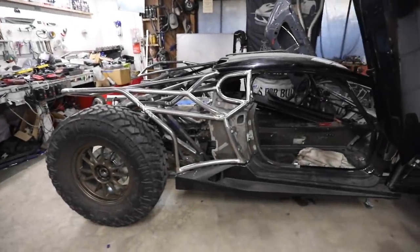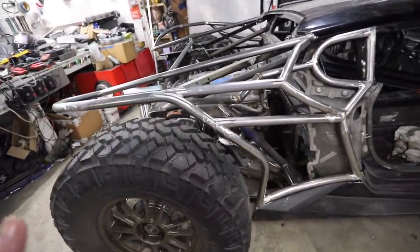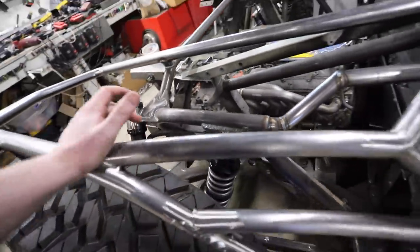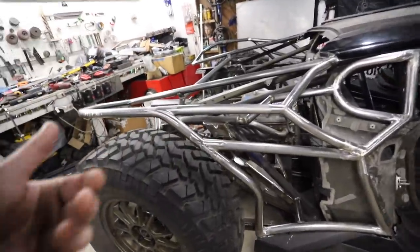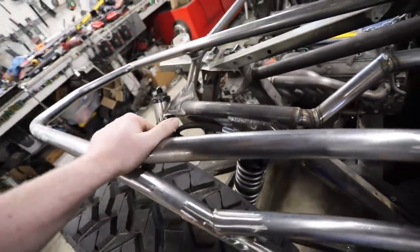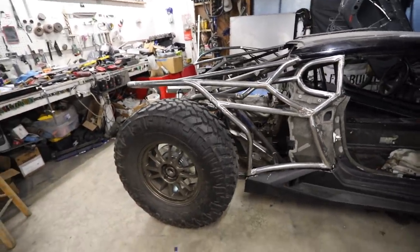With the engine in, it's not too crazy low. It's a lot like what we saw before, but it is slightly lower and not riding level. So I talked with Sam the engineer and he said that most likely in the long run, we're going to need to change spring rates in the rear, but it's better for us to get it built out and do a little bit of testing before we go ahead and do that. So what we can do for now is change the preload — that's going to put some pre-tension on the springs a little bit more and we can see where our back end is.